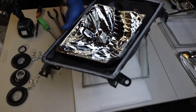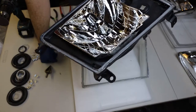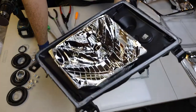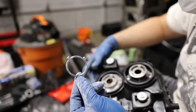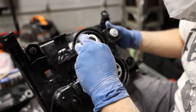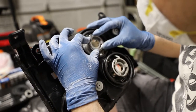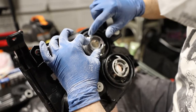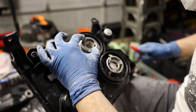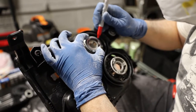What we've got to do is bore out that hole where the low beam bulb went and make the D2S Micro projector fit in there. This washer that you're seeing here comes with your projector kit, and I use it as a reference because everything inside that inner diameter basically has to be removed from the projector housing — that's where the threaded portion on the back of the projector needs to enter the housing so you can fasten it. I use a red Sharpie to mark everything on the housing that needs to be removed, so all this material will need to be Dremeled out of the way.